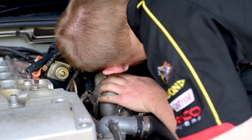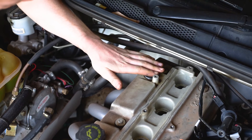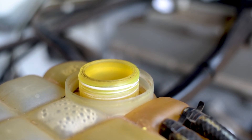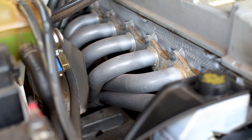Listen out for where the air might be escaping. If it can be heard or felt rushing out of the dipstick hole or positive crankcase ventilation hose, it's most likely piston rings. If bubbles are seen in the coolant, there could be damage to the block or head gasket. The sound of air hissing from within the inlet or exhaust manifold indicates burned, stuck, or damaged valves.